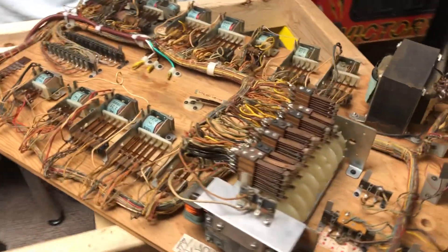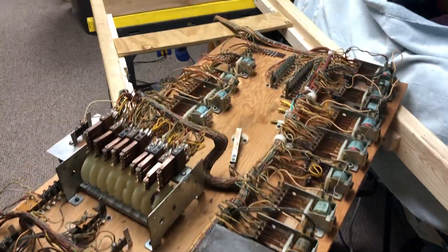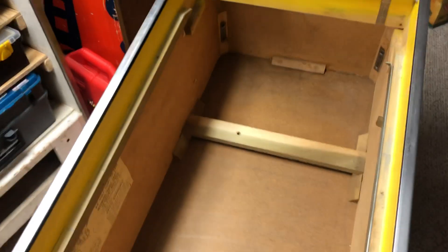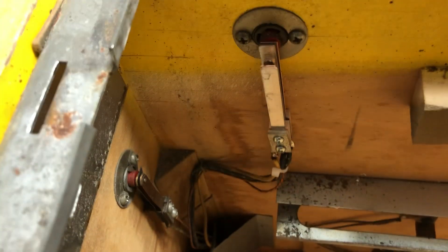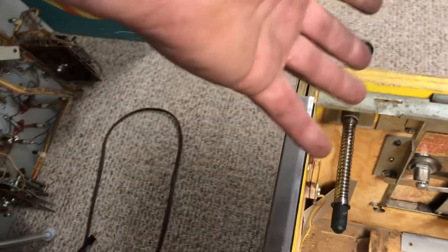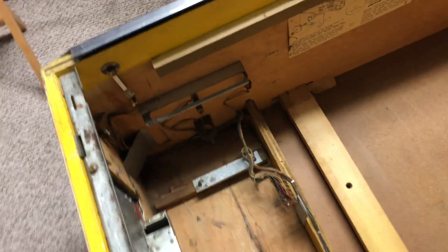This is the only way to really do a score motor board out of an old EM — pull it out of the machine like here. Then you can clean the whole cabinet, fix anything that's in here, like I just put in brand new flipper switches on both sides. It was also easy to rebuild the plunger, go through, vacuum it out, wipe it out, clean as much dirt as you can out, and then put it back in there. It's just a lot easier to do while it's on the floor.